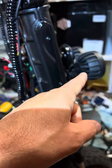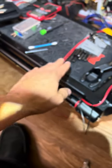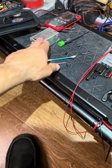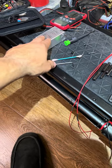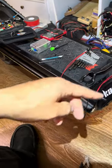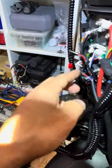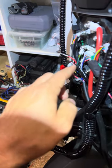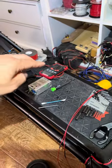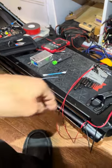We're going to go from the headlights — we're getting 82 volts on the Wolf King GTR — to the wires going to the step-down DC to DC transformer, and then from there to the lights. Actually, let me start with the power. The power is coming from the lights, going to flow into this, and from there into the tiny LEDs.